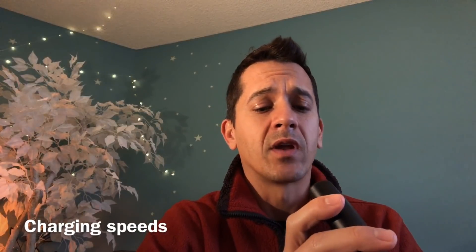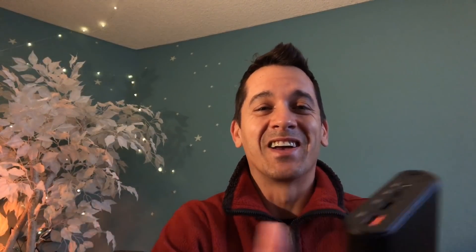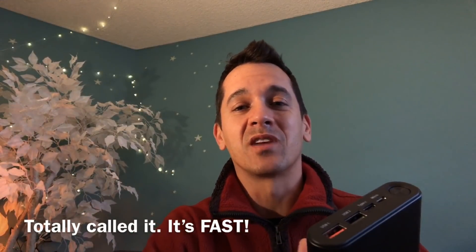So I did a bunch of charging tests to give an idea of how long it takes for the different devices to charge. I tested with the Surface Pro 6 and I tested with the Surface Book 2. If you're using the Surface Book 2, you're going to want the Tanker Elite and you want to charge USB-C to USB-C — it's going to be the fastest charging process. It was about 4% to 5% in about 10 minutes, so in an hour you can expect to bring your Surface Book 2 up about 30%, and I'm using the i7 15-inch model which is power-hungry. While you're using it, that's fantastic — especially when you're out and about. If you're gaming, throw all of that away — even the Surface charger that comes with it, you're still getting battery drain.